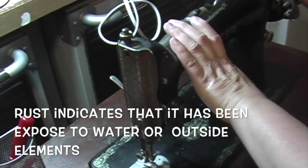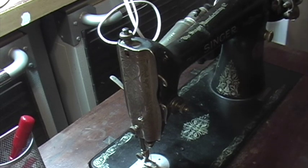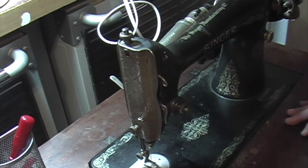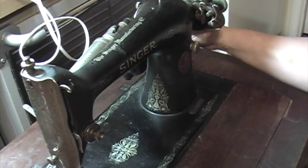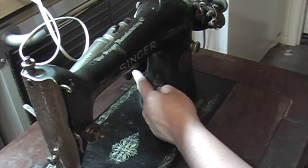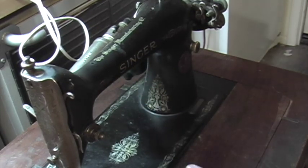The other thing to keep in mind when looking for vintage sewing machines is that it's not frozen. When I turn the wheel on this it's very loose. I plugged it in to check the belts, but they were all rotted and disintegrated from storage. She had an extra belt for the bobbin winder so I replaced that, but the main belt that goes on the gear I had to take off. There's no belt, but the motor is working — it's perfect.